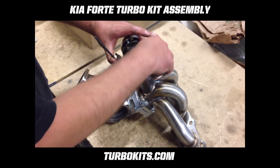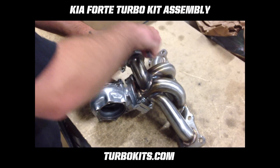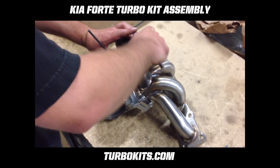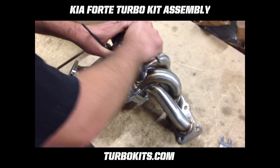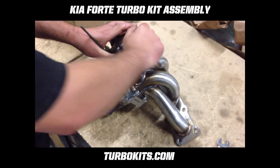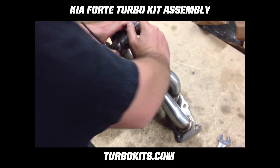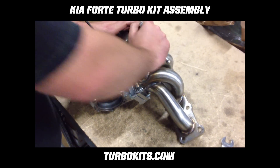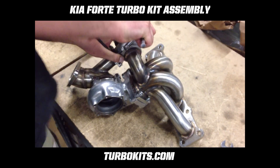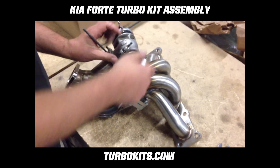A good suggestion: all these nuts and bolts you've seen us tighten over the build — after you get a couple of heat cycles on the car, go back up in there. Be careful, but do it while it is still warm, and re-torque everything down. Metal does like to move when it heats up, so re-torquing makes sure that if anything's moved and loosened up, it gets cranked back down into its new heated position.